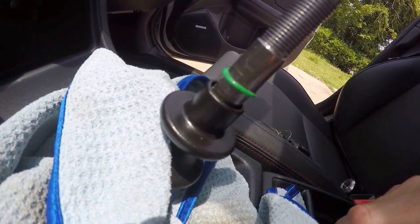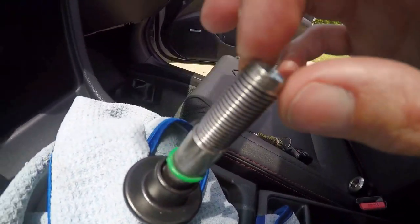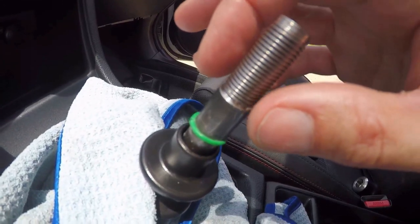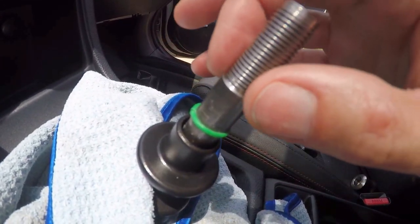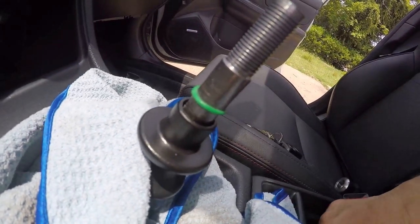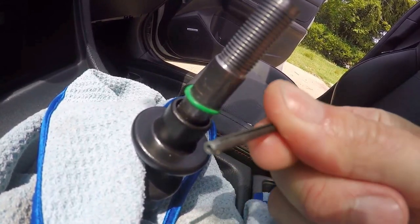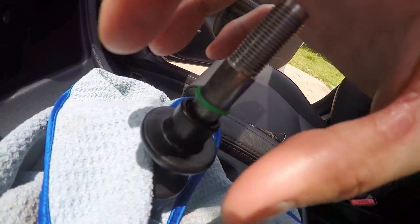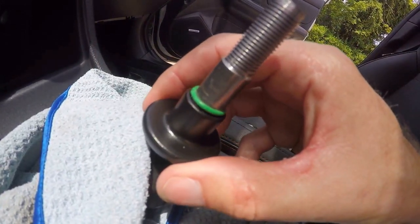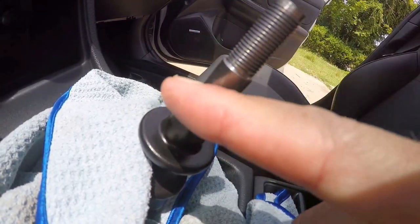You take a tiny o-ring that won't even fit over the top unless you stretch it. The point is to stretch it a lot and make it thin, then roll it down. Take out the cross pin in your reverse lockout mechanism so it'll drop down about a half inch to three-quarter inch — it normally sits up past this o-ring.